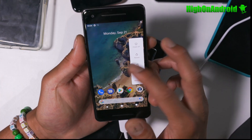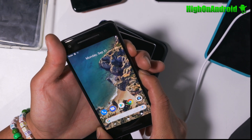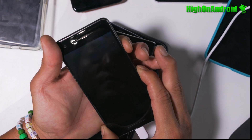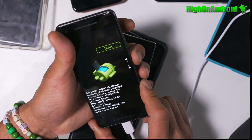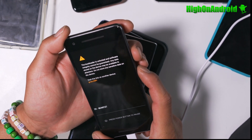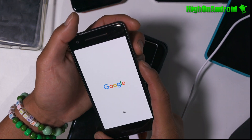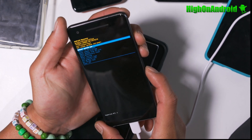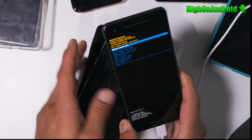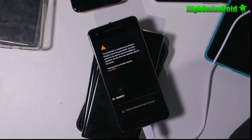Now if you're in a boot loop, what you're going to do is hold down volume down and power to reset. Let's say you updated without deleting data — let it reset with power and volume down, and when it resets it's going to go back into fastboot mode. Release all the buttons, choose recovery mode, and hit the power key. Here you can delete your data — hit power and volume up to get into the recovery menu. Do a wipe data factory reset, then factory data reset. This will wipe everything and reboot, and you should be on your way to having a fully restored Pixel phone.